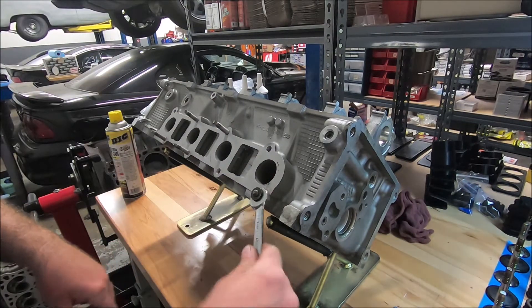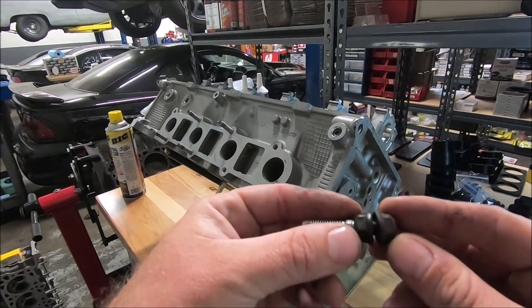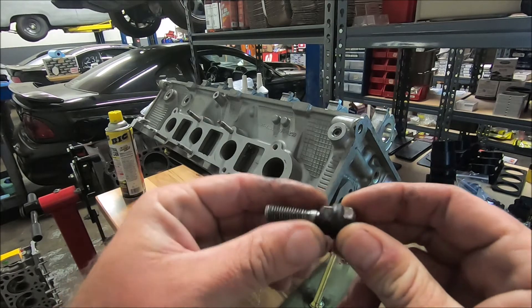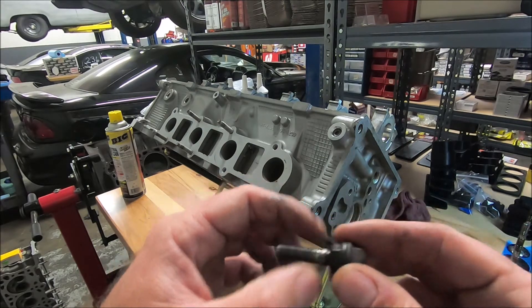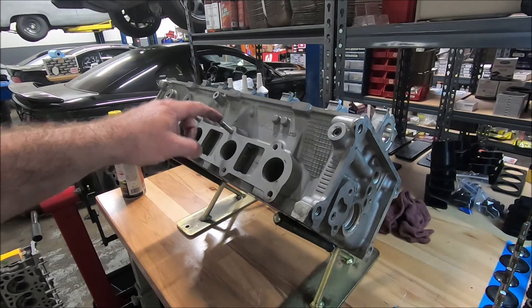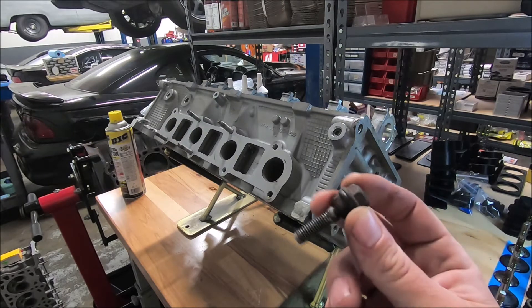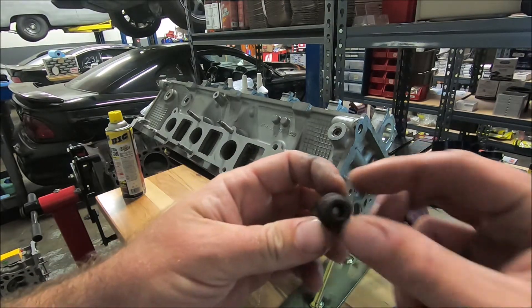It started turning so I'm just going to go ahead and take it out. The idea is that when you have two nuts jammed on there, you really got to jam them together pretty tight. When you jam them together like that, the pressure makes them push against each other and grip onto the stud at the same time. That method works if you're going to take these out for locking header bolts or something like that. The top of these has a hex on them - about seven mil - but they strip out all the time. Definitely spray them down with PB Blaster if you're going to take them out. If they strip off, you can use the two-nut method - jam them together with a couple of wrenches and loosen from the top nut and it'll come right out.